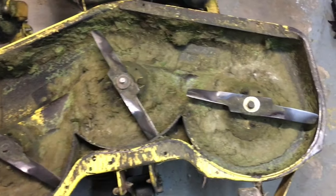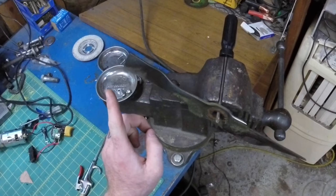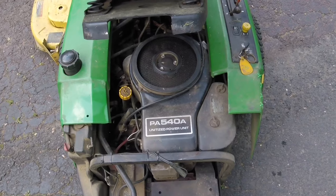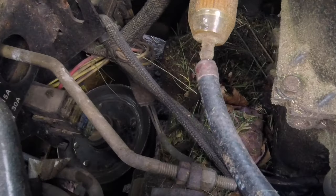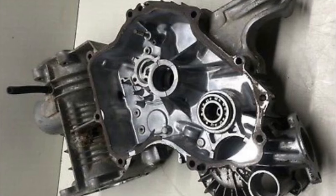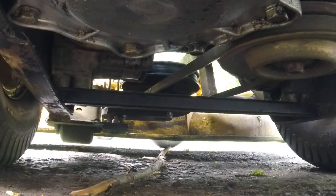Three blades. The powertrain is unique to this mower and is unlike anything I've ever seen on a lawn tractor. Mounted down low for a better center of gravity, the PA540A unitized power unit is essentially the venerable 17-horsepower Kawasaki FC540V with a hydraulic pump bolted on where the oil pan should be. You can see this Frankenstein setup better from underneath — it's the most complicated oil pan I've ever seen. The pump's piston even has piston rings like an engine. Theoretically, this thing should outlast humanity.